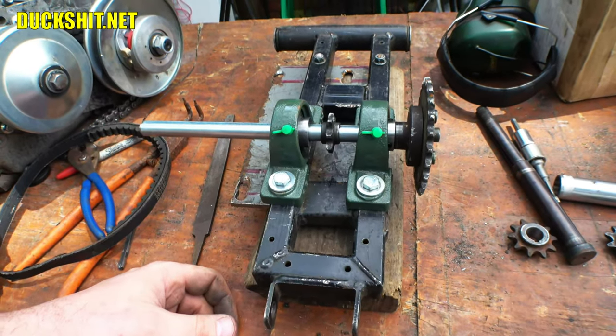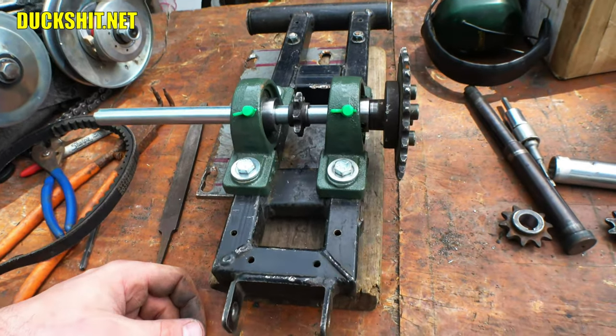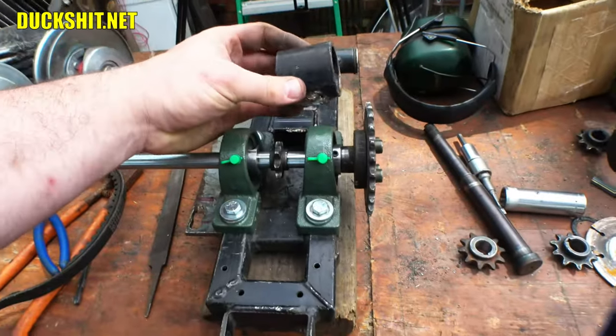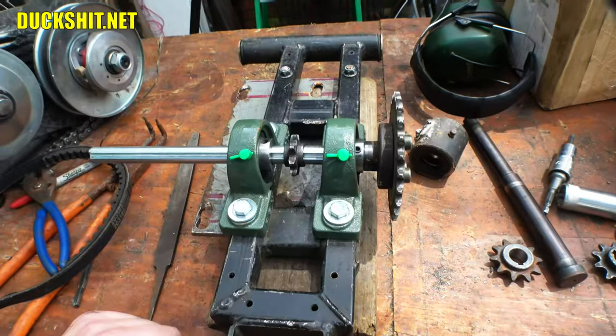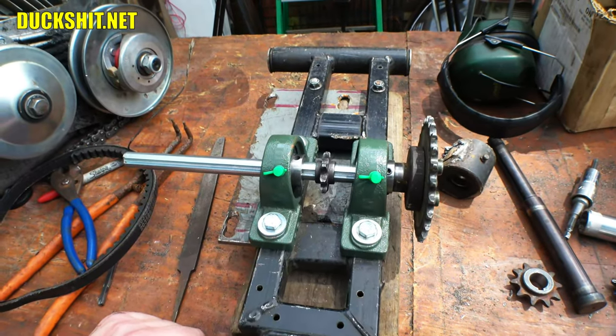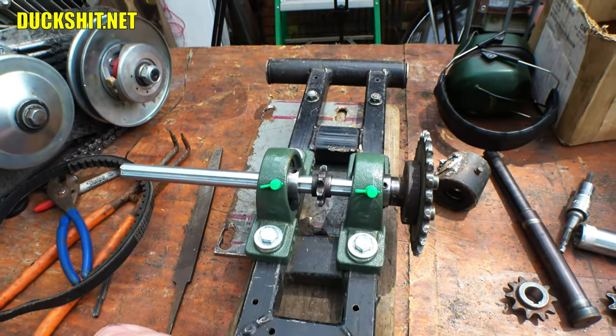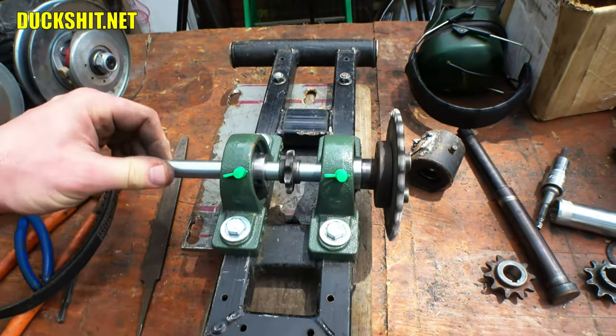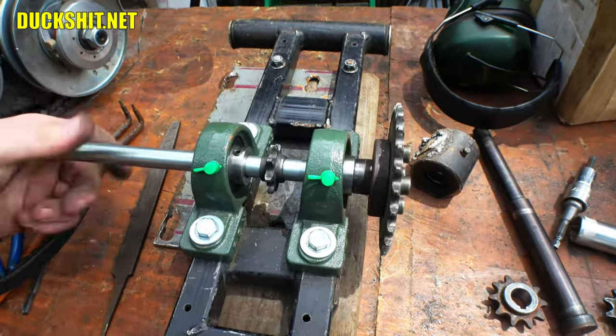Really, there was just a lousy design on their part, mounting the jack shaft inside of this thing, which can twist. Like I said, even a stock engine will wrap these things up on go-karts that are affected by the problem, and mine just happened to be one of them. So, anyway, better than ever. That's a fact. Look at that.